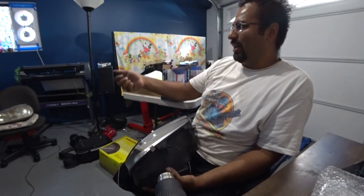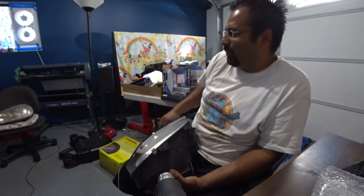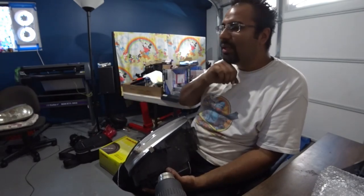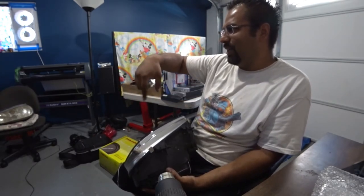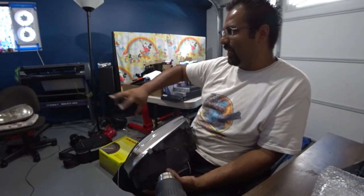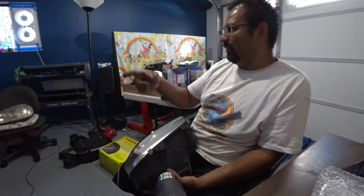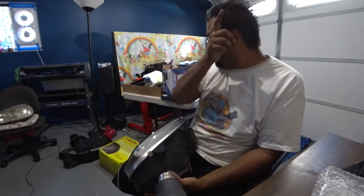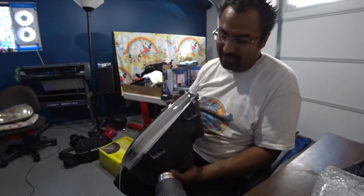You literally unplug under in your center console in the rear, where your ashtray sits in the back. Pull that out. You'll see the e-brake cover right there. It's one bolt and it has two nuts on each side. You take that off and it loosens both cables. Now there's a trick to doing this quickly.